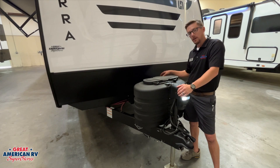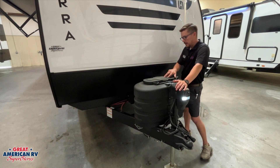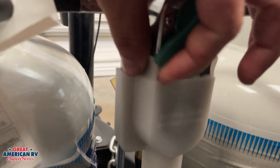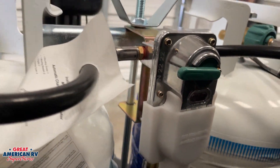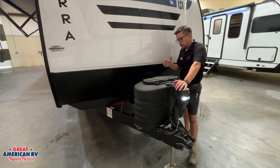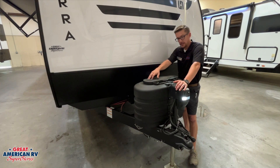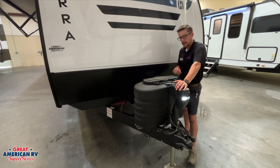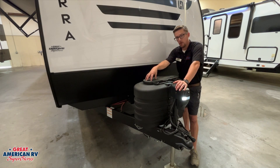We also want to check our power on here and make sure we have a good solid battery. Behind that, we have our dual propane tanks, which are controlled by our dual propane regulator. That regulator has a little selector switch — we'd have both tanks on, choose which one is our primary, and when that tank runs dry it'll start pulling from the secondary tank automatically. When you notice the primary is empty based on the signal on the regulator, you can swap over to the secondary and get the former primary refilled or replaced.